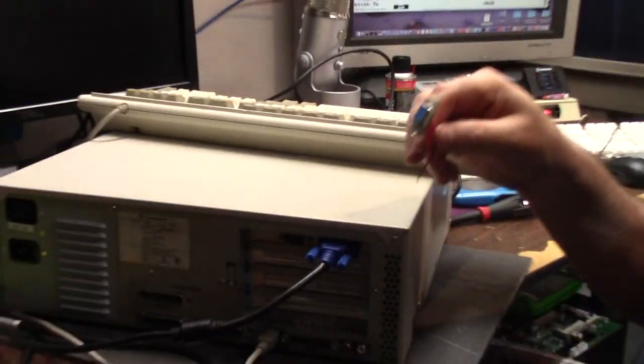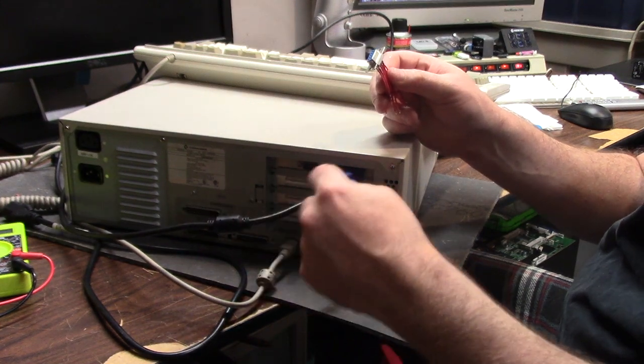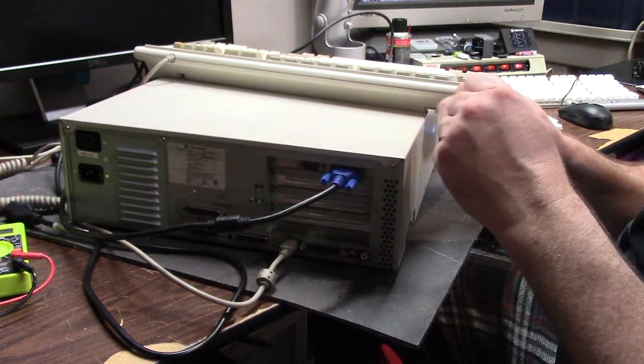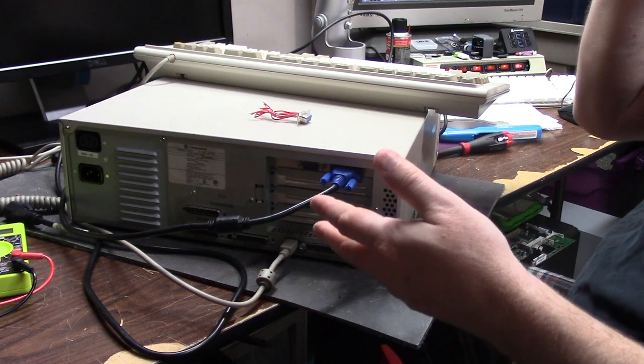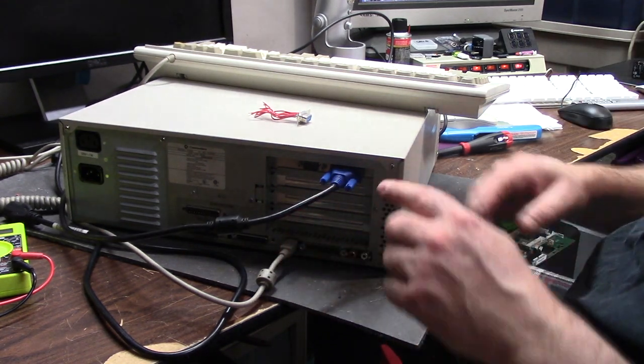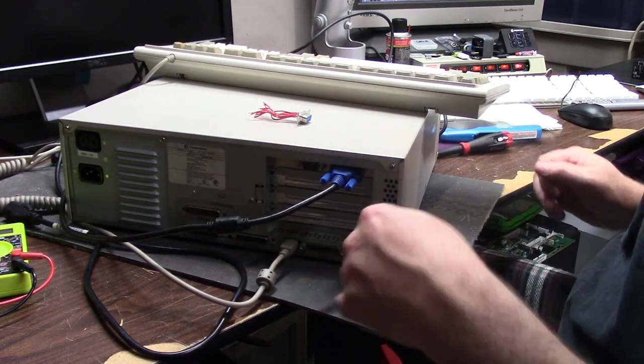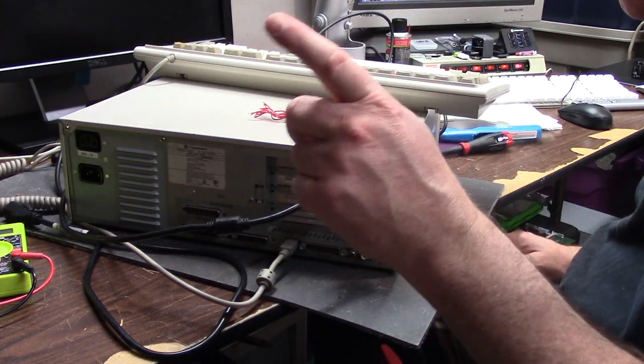I'm going to use the VGA's individual wires. You can't see that. I'm going to bridge all these, and I'm going to use the VGA's individual wires. It's going to have 15 of them, but some of those are grounds too. Usually on the inside of these cables, they're manufactured a little better, and each cable individually is shielded and has a small ground wire attached. So we'll bundle all the ground wires into one big ground.